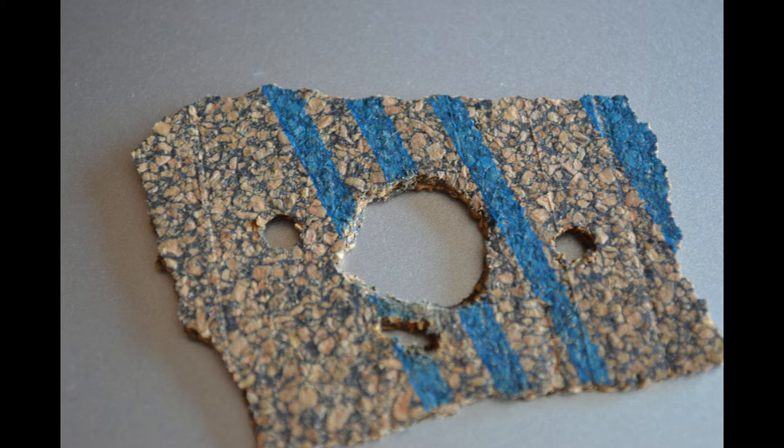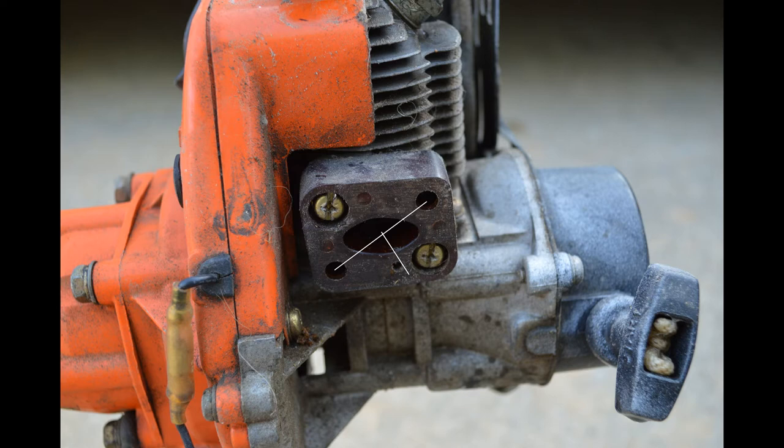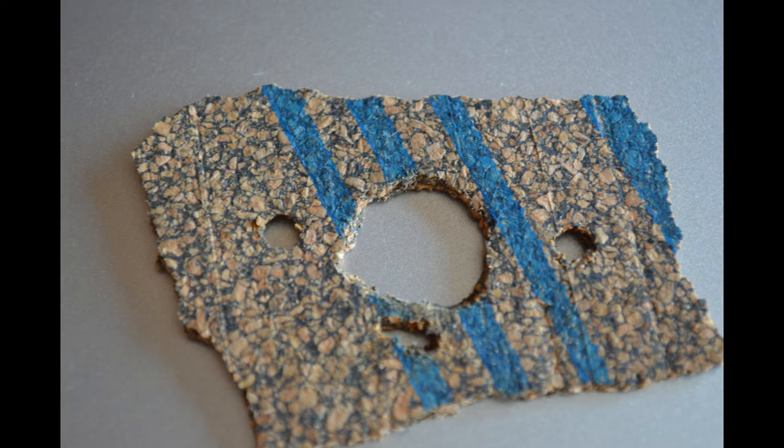So now that explains the hole on the carburetor, but as you can see, that hole at the bottom of my picture of the gasket is not perfectly round. That's because the hole on the actual block is not lined up, at least to fit the current standard carburetors. If you drew a line connecting the two holes on the old carburetor, and then from the midpoint of that line perpendicular, today that hole would be lined up with that perpendicular line, but it's not, it's skewed a hair, as you can see in my gasket, a little bit to the left. So take the gasket, put it up against that insulator block, punch the hole, and then connect the dots so that the air will go from the insulator block through that little passage on the gasket to the hole in the carburetor. And so now you're pretty much on the home stretch.